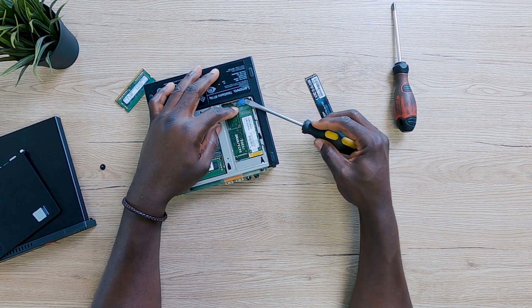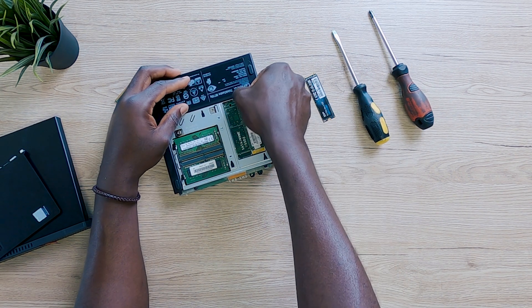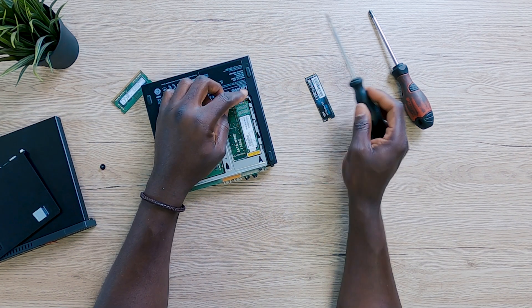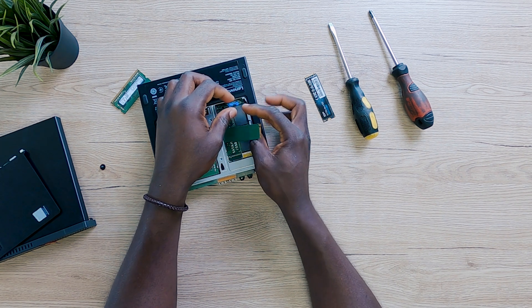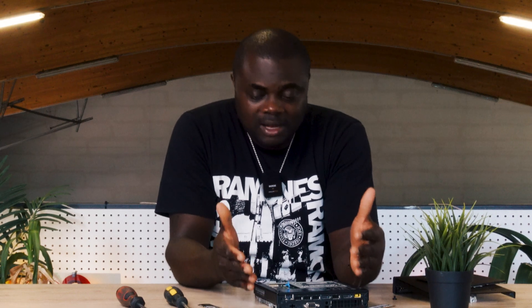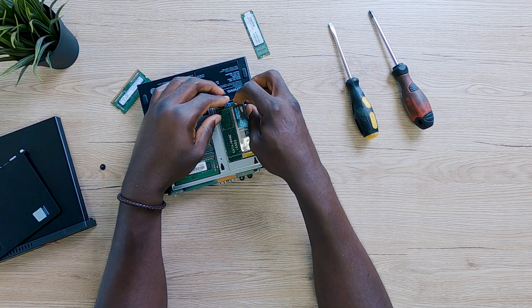You just place the flat-head screwdriver by the chassis of the PC and push this up — it's going to neatly take out the plastic clip. If you try to struggle with it by hand, you may end up cutting the cable if you're not careful. But with this flat-head screwdriver it's just a little hack. A subscriber was very grateful for that tip. Speaking of which, if you're not subscribed to this channel right now, please go ahead, support the channel, subscribe, and click the like button if you've found value in this video.